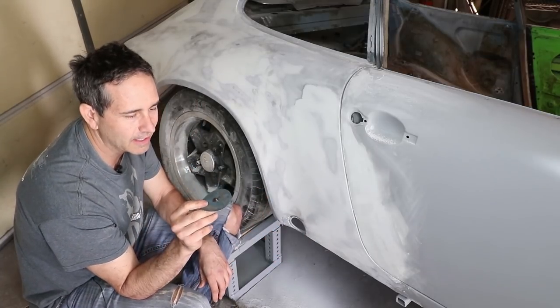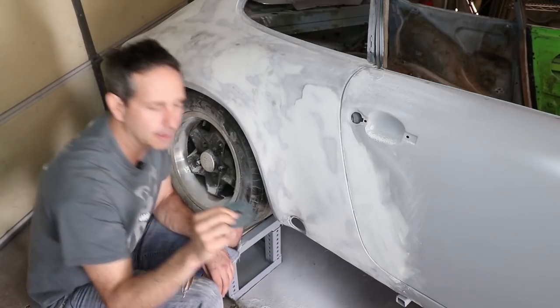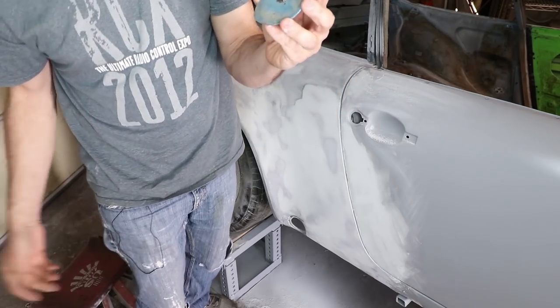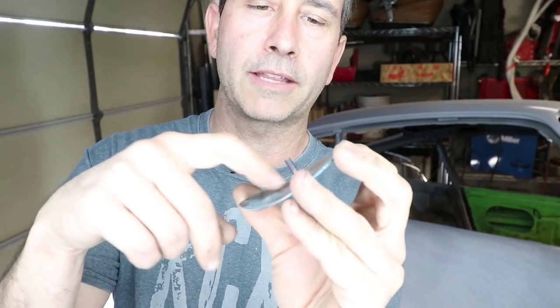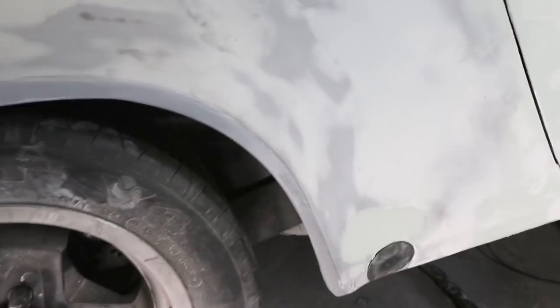The only thing is these came with my car in a box, and there's a screw on the back side that's been sheared off — and I have two of these, both sheared off. I'm back from the store with the hardware. So now I have a longer screw and I can attach this using a nut with a little bar that spreads across the back. I just TIG welded it — real quick tacks, just like the factory did with a countersunk screw.